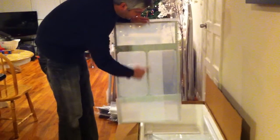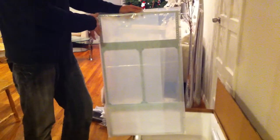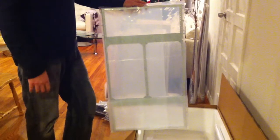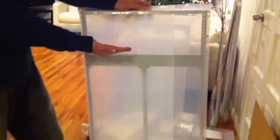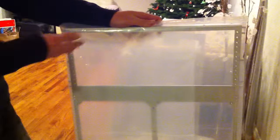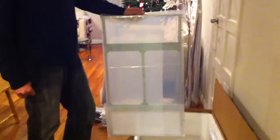You can see on here there's one large cutout. This is for one motherboard. That's the other motherboard cutout. And then this is the panel where you can choose to mount 4 PSUs or nothing if you want to use the space for radiators as much as possible. You can even get 1U server bays that will attach to this, so you can mount 1U devices such as KVMs or network switches, whatever you really want. The case isn't designed to mount a really heavy server or UPS in there, although I wouldn't be surprised if you could get away with it, but certainly I know Jim wouldn't recommend it. If you do want to do that, he might be able to custom make you a pedestal that would be strong enough to do that.